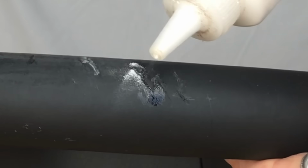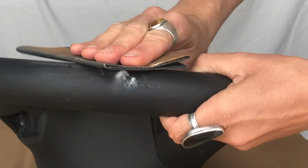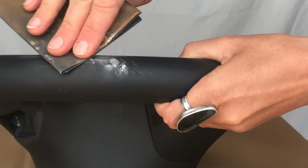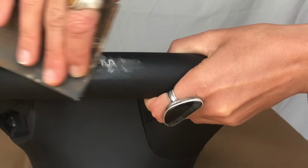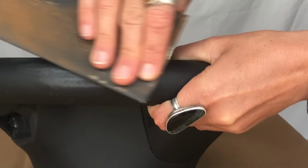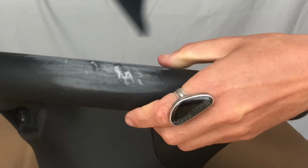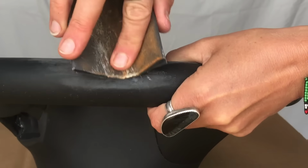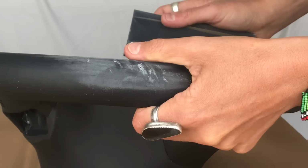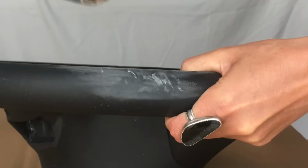This is baking soda. A tiny bit of baking soda catalyzes the super glue, makes it like an epoxy, which for something that moves a lot, where the leather is moving freely over the substrate, you wouldn't want to use. But for something like a steering wheel, a rigid epoxy is okay, as a void filler. And it's going to need some more in there.